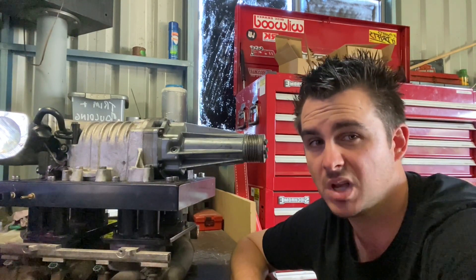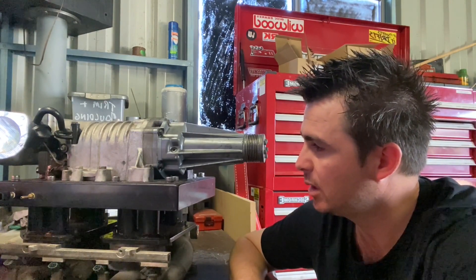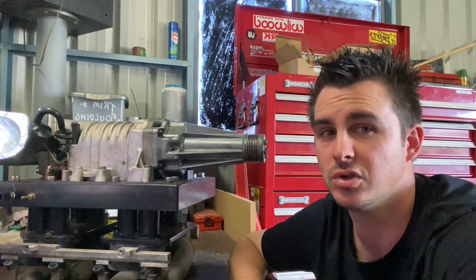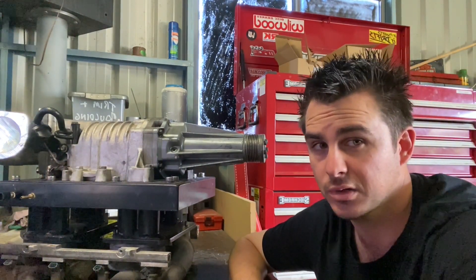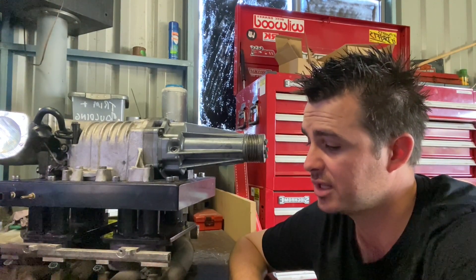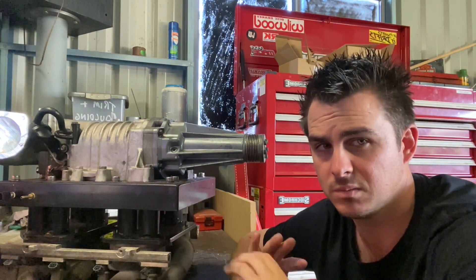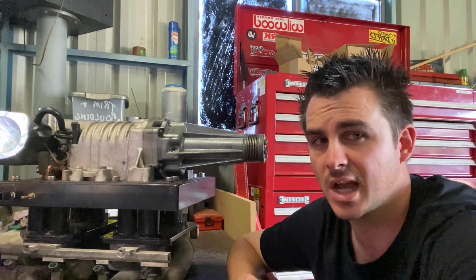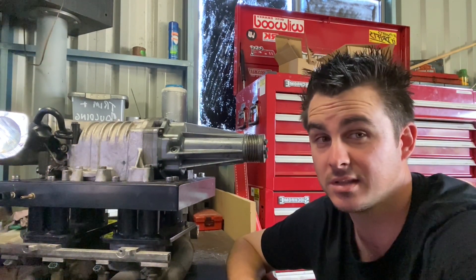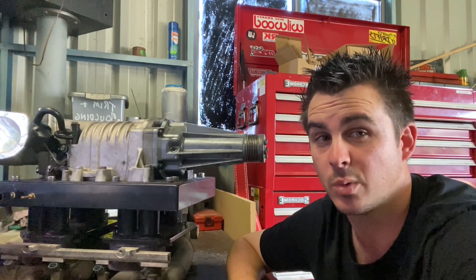It's worked great — no issues with belt slip or alignment. The one problem this whole setup has had is the issue that everybody comes across with these on the 1UZ: intake temps get up pretty hard. At the last track day I decided to give it a test at Matsuri on their wet skid pan — three-minute runs, leave it in first gear, basically ride the limiter for three minutes. It got up to a little bit over 120 degrees Celsius, so fairly cooking.